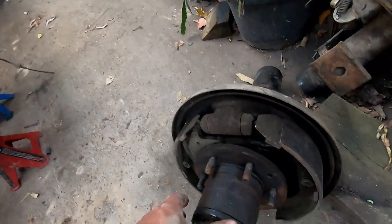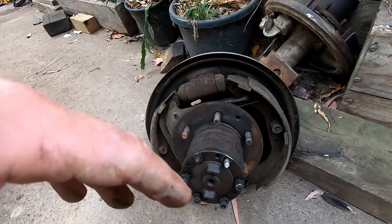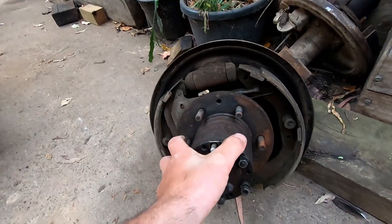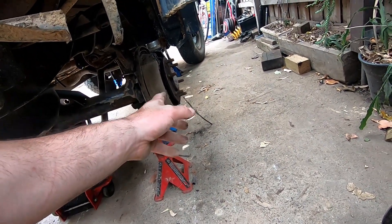That way, if we break an axle, all you've got to do is undo these nuts and slide your axle out and you can fix it. Or do a wheel bearing — it's exactly like when you're doing the front one, you just tap out the races and tap new ones in, not like on something like this where you've got to cut the old bearing off.